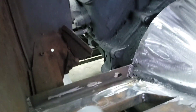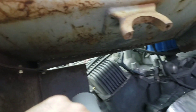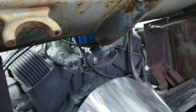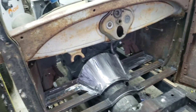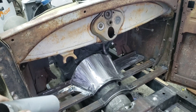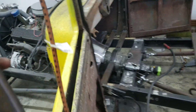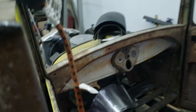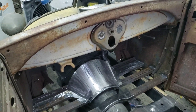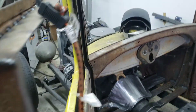We're going to be coming up from the bottom corner here of where the angle iron is, and just in front of that is where our actual firewall will bolt up to where I stepped back the entire front of the gas tank. And once we get to that, pretty much the cowl is ready to go. I'm going to be layering in a floor pan after all the rest of the lower structure is put together. But for now, it's pretty solid. If I pick up on this side of the car, it pretty much doesn't want to give. I'm just pretty happy with how this is going.